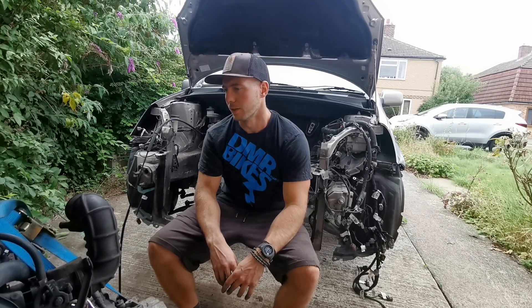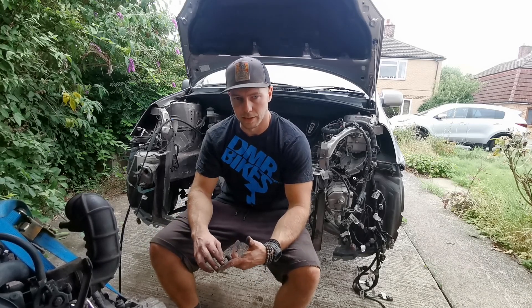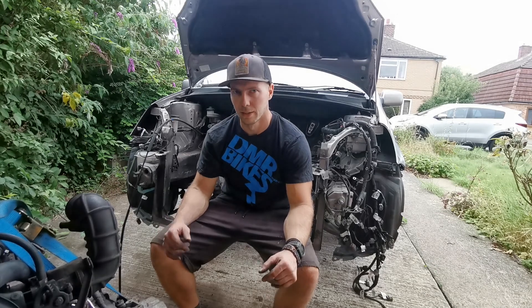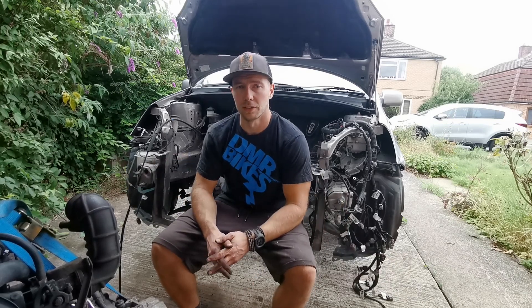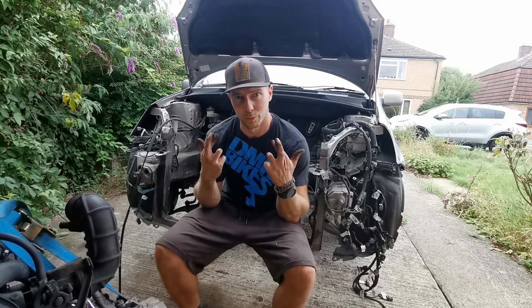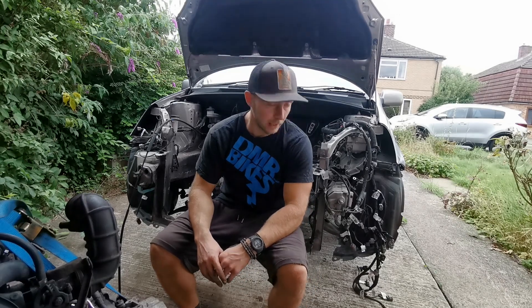I know there was the issue with driveshafts. I found a random YouTube video of a guy with a 2ZZ Yaris - he ran what I reckon were Mark II, like 2006 to 2011 Yaris lower arms and hubs. It wasn't in English so it was quite hard to understand from the comments. But I have ordered one set to see if it will fit - I think it takes the CVs from the Celica, it's just the width. The Celica shafts are a bit wider - there's like 40 to 50mm, maybe a bit more in width that needs to be added. If not, it's custom shafts. Even if we add the width, the car's going to be wider at the front - about 20mm wider each side - so it's just going to be low and wide.